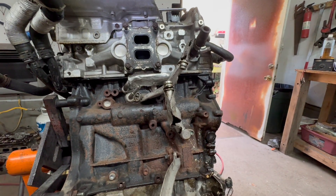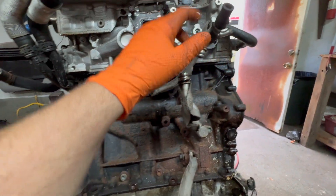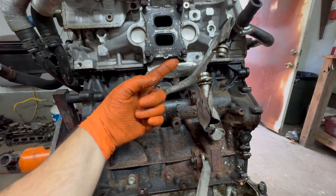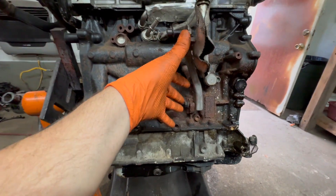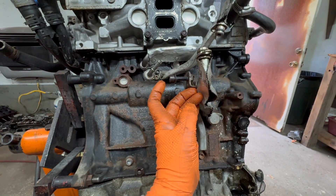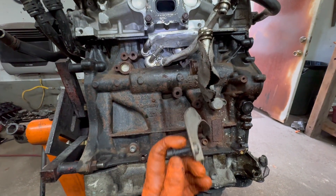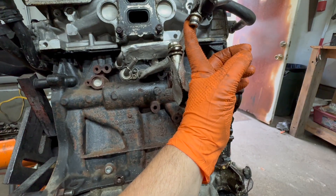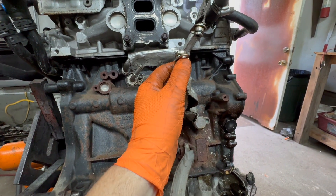So to recap: one, two, three, and four — four bolts here. These two you get from underneath. This one is 13 millimeter, and this one is 6 millimeter Allen key. These two were spline drive — triple square — 8 millimeter.